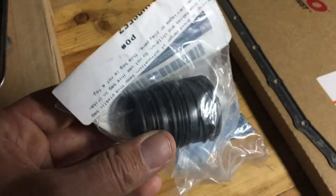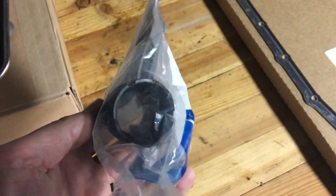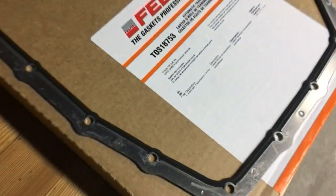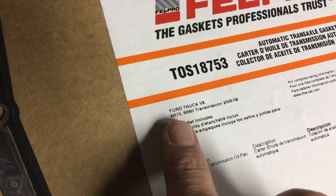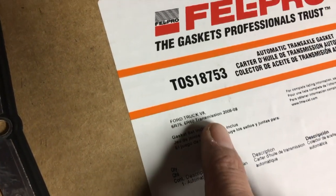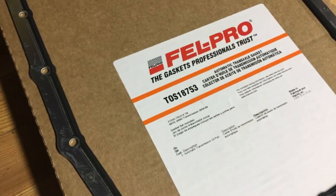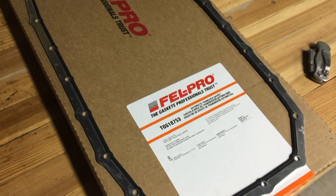This is the replacement for the offending part — the plastic connector that sits in between the transmission housing. Hopefully that'll stop our leak. Over here on this pan gasket, if you zoom in just a little bit, the description says it's for the 6R75 or 6R60 transmission from '06 to '08. This is actually the 6R80, so I'll take a good look at the gasket when I pull the old one out — hopefully it matches up, otherwise that's gonna be a little bit of a showstopper.